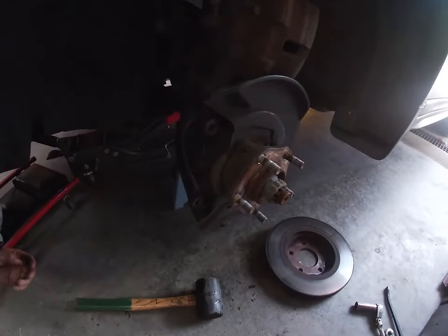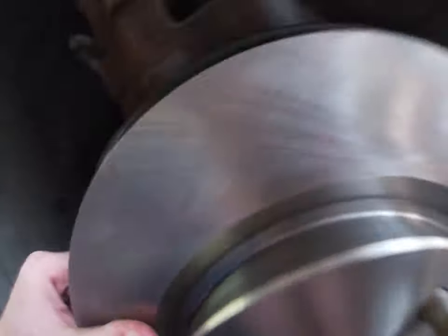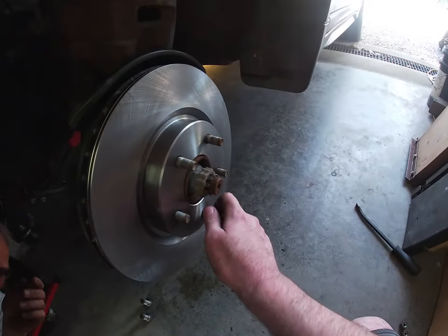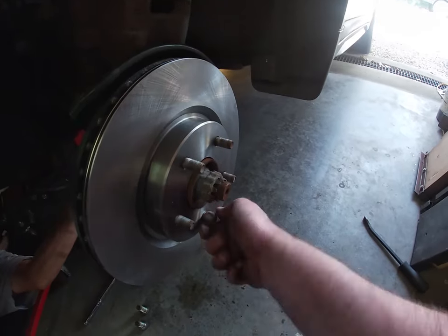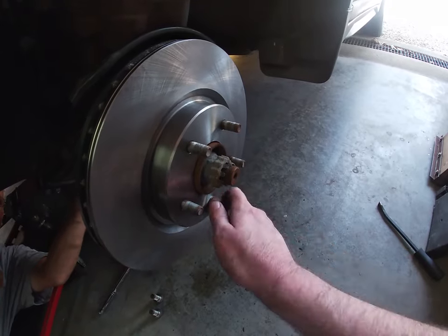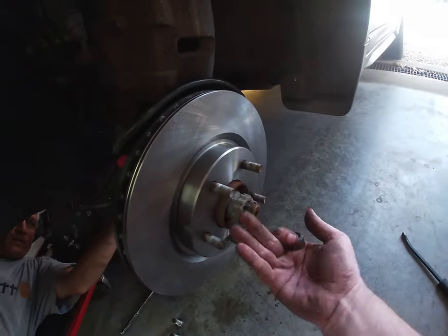She's loose! Now we're ready to put the new rotor on. The new rotor installs simply — just slide it on. It won't want to sit flush, so what I do is take a lug nut and put it on the bottom stud to hold it in place. One thing to pay attention to: not all rotors are the same — some have set screws that hold them on, either here or here. Double-check that first before you go beating on it and it turns out there's a set screw. The lug nut is there to make it sit flush.